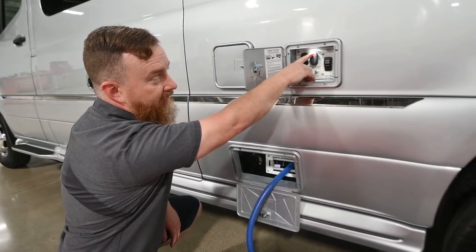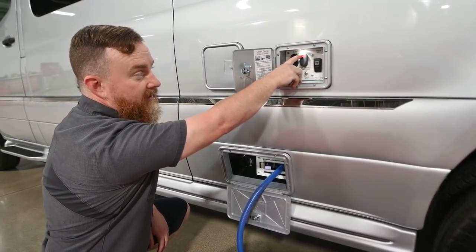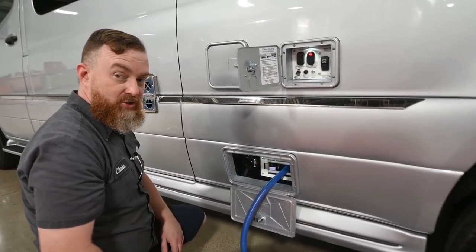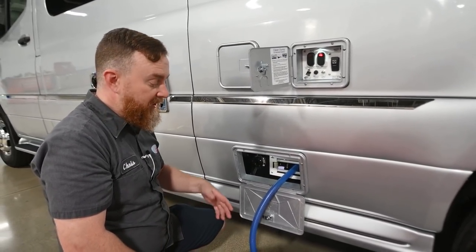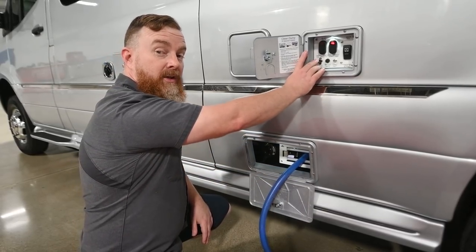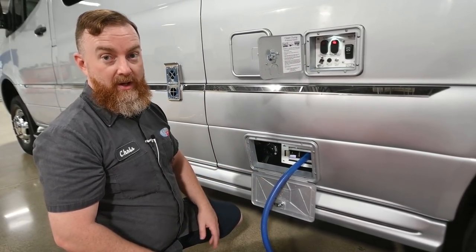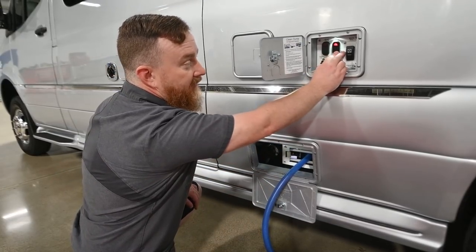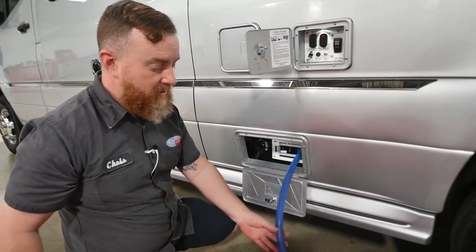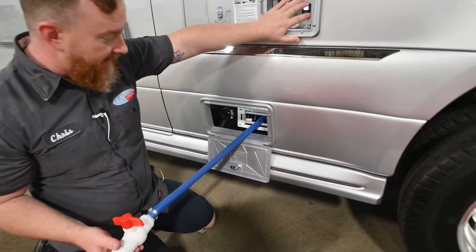Then you can open the gray valve. When doing the gray water, you just pump it straight out — open the valve, turn the pump on, pump the water straight out. When you hear the pitch change on the pump and see the water start to chug through the hose, go ahead and turn it off. Do not run the water pump without water coming through it over time — that will cause it to burn up. Close the gray valve. When returning the hose, wind it back and forth across the drum so it sits nice and flat.